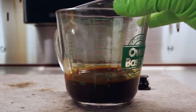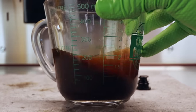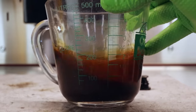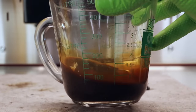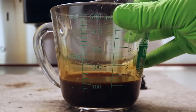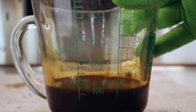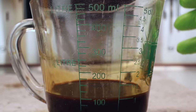All good questions. You're also probably thinking, Charles, this is the sludge that was left in the bottom of the crankcase. Why would you want to leave this in there? Well, for one, we're not going to be doing extended services on this, so there should never be sludge in the bottom of the engine. And two, if we have the car all warmed up, all that sludge is probably circulated through all the oil anyway. It's not like we're taking the pan down and cleaning the pan out. We're simply just looking at the difference between the extractor and the drain plug. So what do you think? Is this amount enough to justify taking the drain plug out, or are you comfortable with this much oil getting left behind for hopefully the next service?